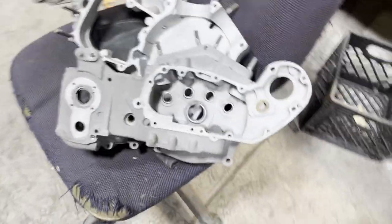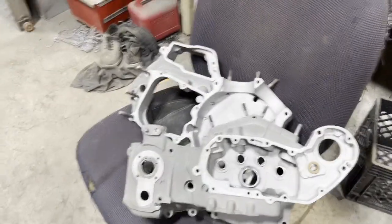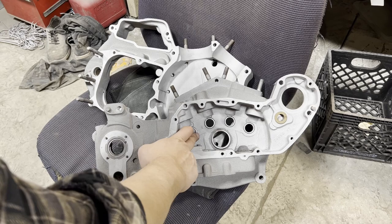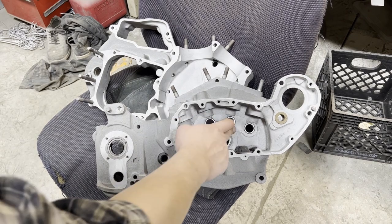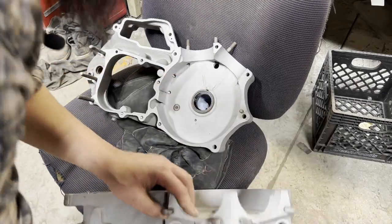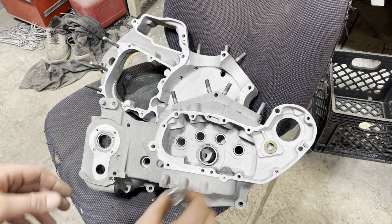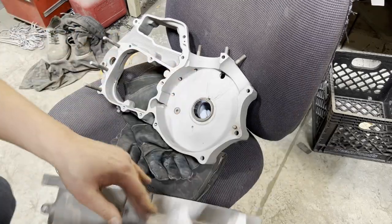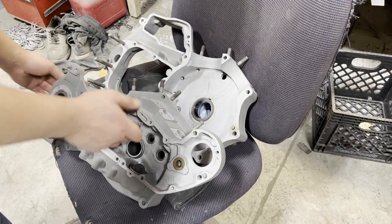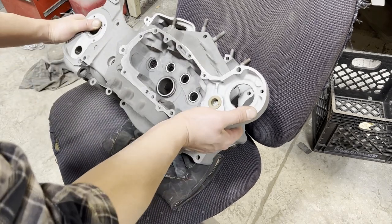There we have it — the other halves of the case are in. Done. Cam bearings are in. Obviously I didn't assembly lube or anything. Some people use Loctite on here — I've seen people use red or blue Loctite, but if I was going to lock these bearings in and didn't want them to move I would probably go with a green Loctite. It's not as common but I'd put a little bit of green Loctite on the outside, especially if any of these tolerances on the case are a little worn out. In this case everything is pretty good. I purposely didn't want to go too far since I know these lips are broken — I'd rather leave it out and push them in a little more later than overdo them.